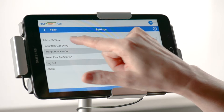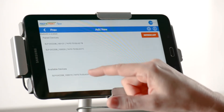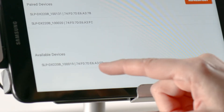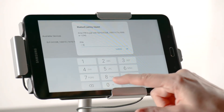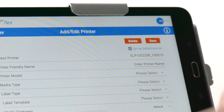To fix this, go into your settings and select printer settings. You'll see a list of devices that have been previously paired to the tablet as well as a list of devices that can be paired to your tablet. Select a printer to pair and enter the pin of four zeros to successfully pair the printer. Then select your newly paired device and select set as default printer.